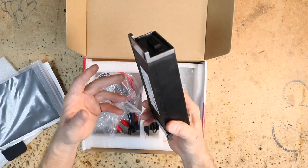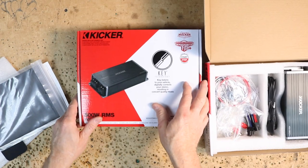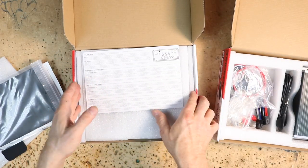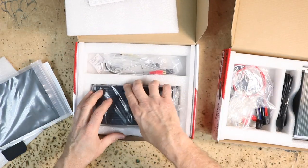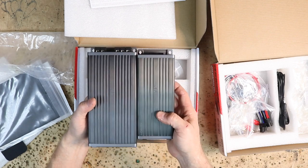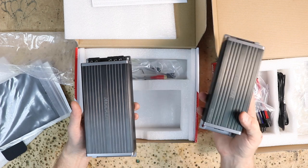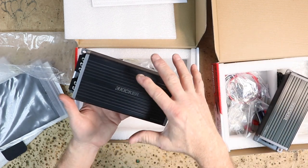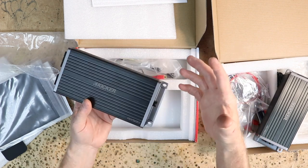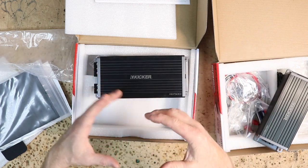For the last two years this thing has been doing amazing things, but we've desperately wanted a sub amp to team up with it. That brings us to today: the 500.1 — a sub amp, 500 watts just for the sub. Comparing the two, it's a bit bigger than the original Kicker KEY, but together it's a great five-channel amp solution. You can do all your mids and highs, EQ them, time-align them, and fix the problems that factory radios have.